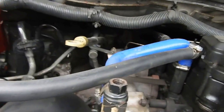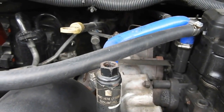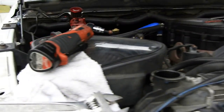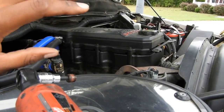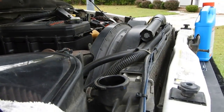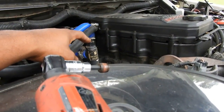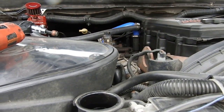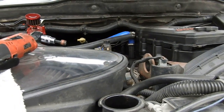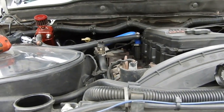On 6.7s — I don't know if this is the same for 5.9s — you're going to have a vent right here. That is where you vent the system when you're adding coolant. You don't add coolant when the engine is just sitting; you need it running, because you want the water pump turning to pump water into the engine block. If you have the heater on, it'll pump it through the heater core. When you vent your system, don't just drain and fill it up and think it's good — you've got to keep this vent open so the system can burp itself. Because if it doesn't burp itself, the air bubbles inside the block can cause damage. Over time, the pressure from those little bubbles exploding inside the cylinder chambers and coolant jackets can cause pitting corrosion. You don't want that.